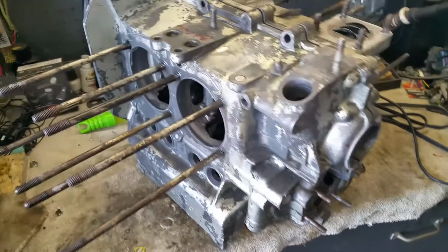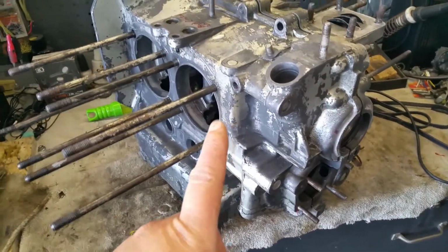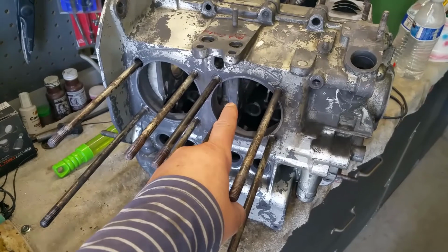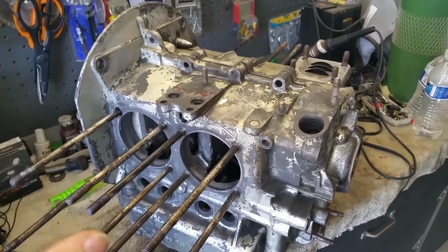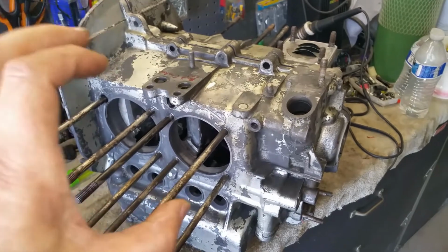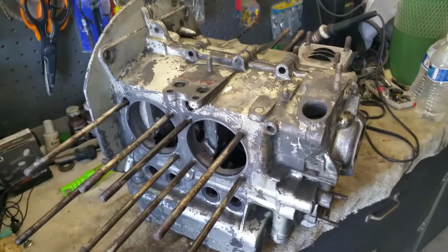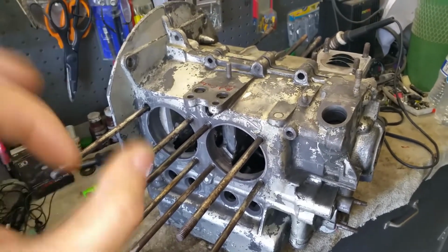We're going to go bubble top. That way I don't have to machine anything on the inside. And I'm going to get it pre-ordered with 90.5 registers for the cylinders. So everything is just going to slap right in. My bearings are all going to be standard: standard thrust, standard saddle seats, standard crank. Everything's standard because there is zero wear on the journals. Zero. I checked them out and I just couldn't believe it.